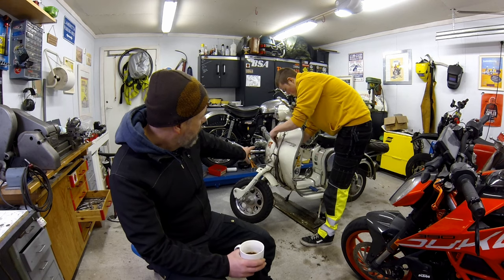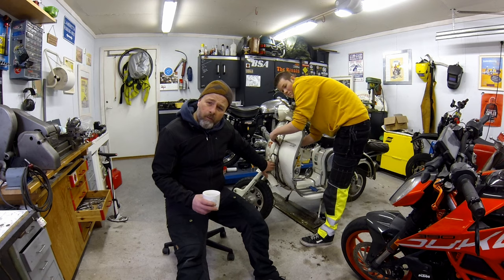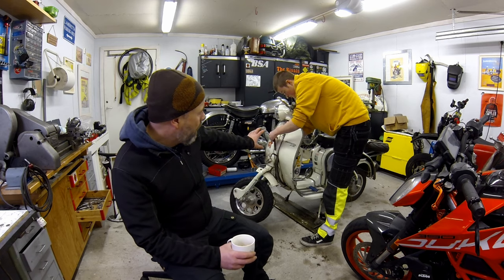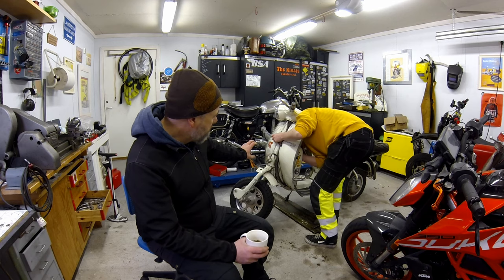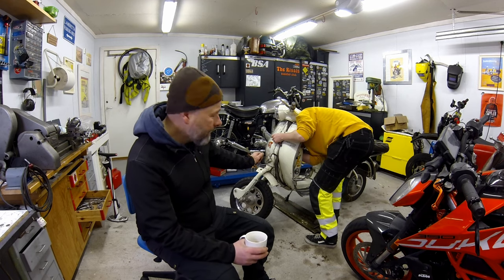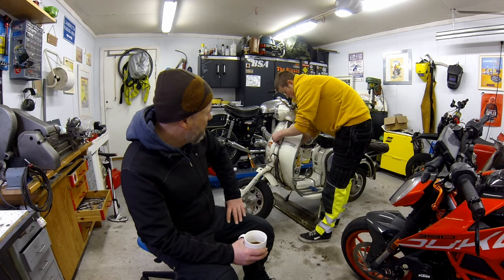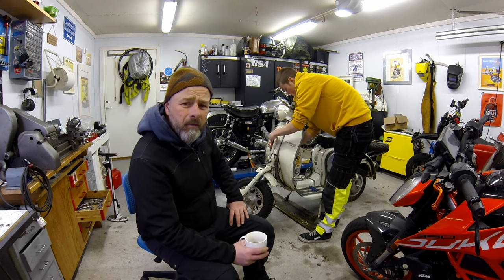I've bought new bearings and new bearing cups. This is also supposed to be chrome — I've got a new one from Rimini Lambretta on its way. The job at the moment is we're going to take off the whole leg shield because my wiring loom has got really stiff and dodgy, so I'm going to swap it out and change all the cables because they've started to look really bad on the outer cables at least. So that's sort of the winter spruce.